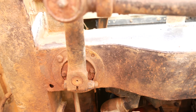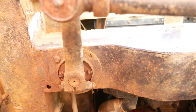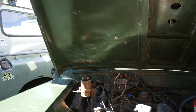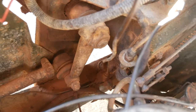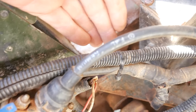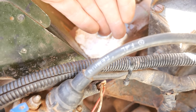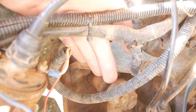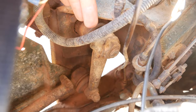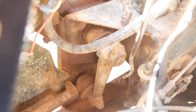So that's pretty much it for the steering underneath the vehicle. We'll go into the engine bay because there's one more tip. So this here is your steering box. There's a series of four studs here and four nuts. You've then got a shaft that comes out of here, another nut, and then a lever that goes down. And you've then got a shaft that goes forward to the steering relay.